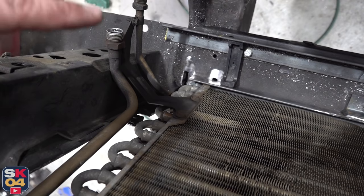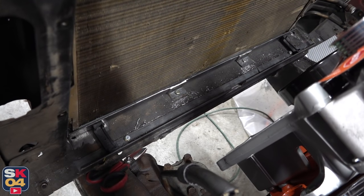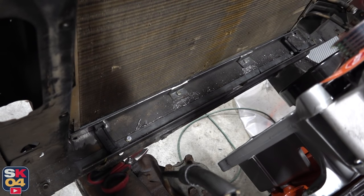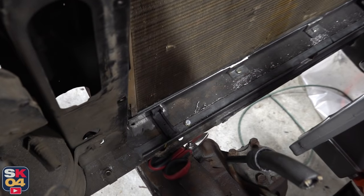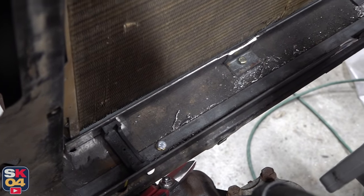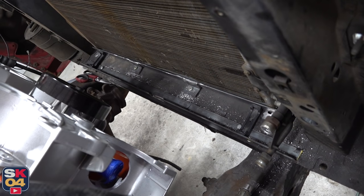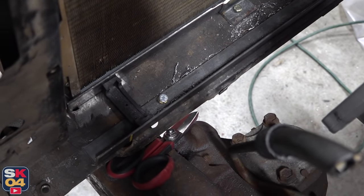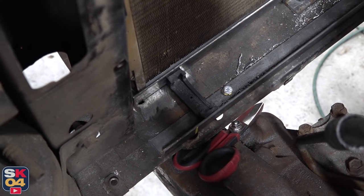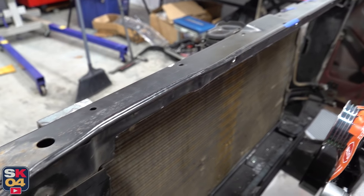Those are the two screws right there — not a big issue, but it never hurts to be too safe. In the bottom of the core support I made a custom cradle to hold the radiator and the back side bottom portion of the condenser. It's a couple pieces of angle iron and a couple brackets. The first piece of angle iron is sitting up underneath the condenser nice and tight — I welded a couple brackets in there and bolted it to the core support so that is extremely tight. There's also another piece of angle iron coming across the front that holds the radiator as well as the fan shroud, and it too is bolted to the core support. I was able to use two of the traditional rubber isolators, so the radiator has that nice soft cushion to sit on. Up at the top where it gets a little tight underneath the core support, I'll use those gas tank insulating straps.